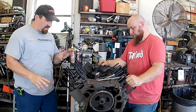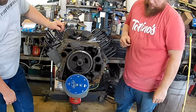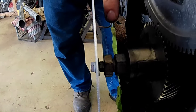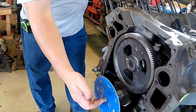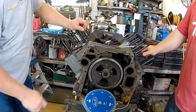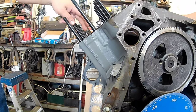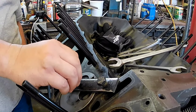This morning I came in with my Motion Pro 15-dollar cam degree wheel that I got off Amazon. I took a bolt, put a nut on it, and drilled the center out to put a small bolt in so I could mount the cam degree wheel to the bolt. Then I took a piece of 3/16 plate left over from where we Z-cut the frame of the International and threaded the center of it for a piston stop.